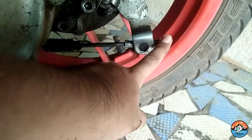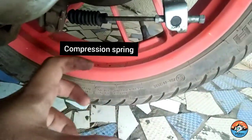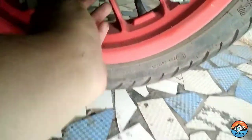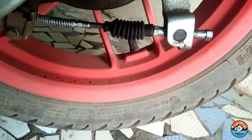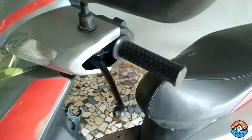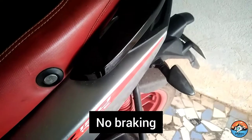First thing — protection. The brake system will have a 10mm bolt over here, a 10mm nut over here to lock it, and a rubber. Inside that will be the spring. When you press the brake, it makes the spring contract — you have to push this rubber stop. When you press the brakes, the spring will compress and your brakes will be applied. Look at this brake — it's very loose. Rotating the wheels, pressing the brake — nothing's happening.